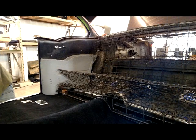So on this specific model of car, the car itself was brought to us in pieces, and we also had to install and modify a few spots to make the back seat fit properly. If you can tell, there are two brackets on each side of the seat frame that we had to fabricate and weld to the seat frame so that we were able to bolt it to the floor cross member to properly secure the seat. This is a finished picture of how the seat will be sitting in the car when it is done.